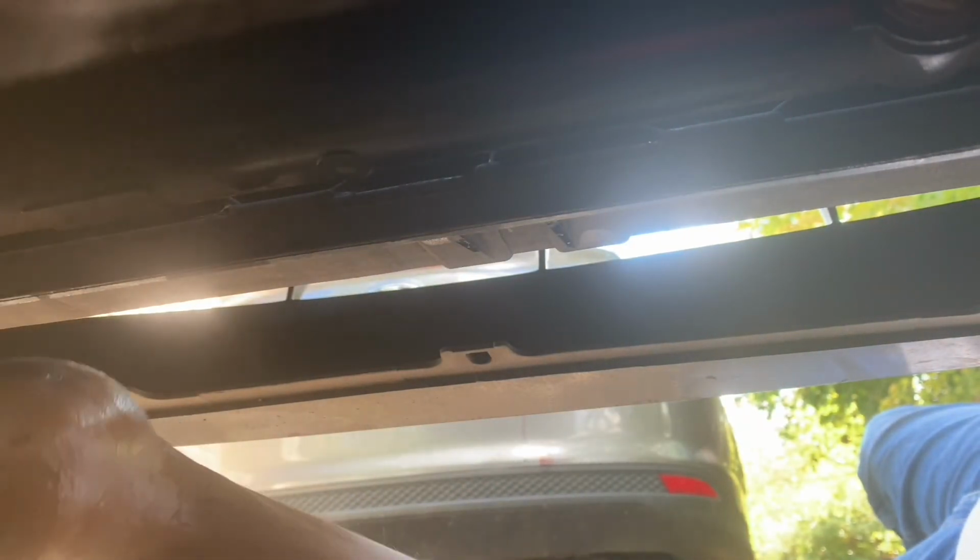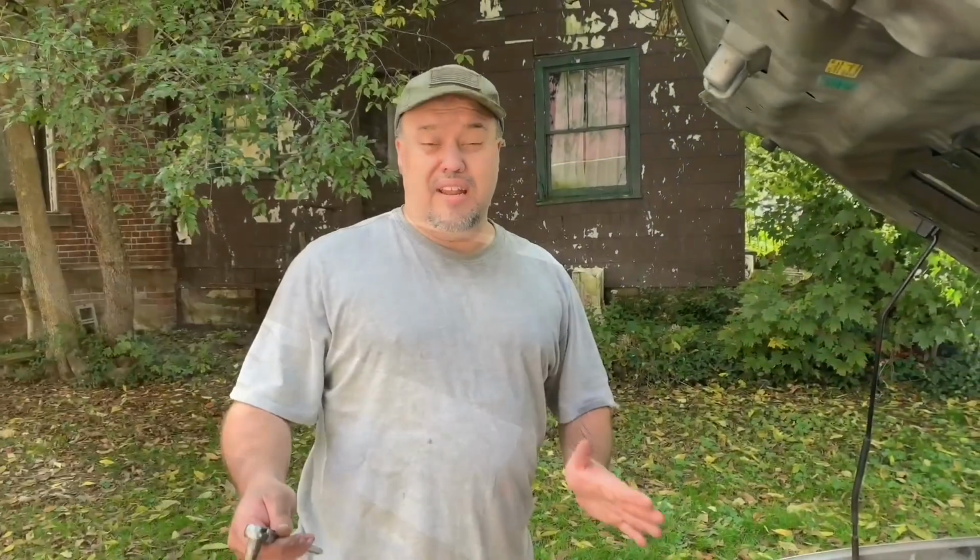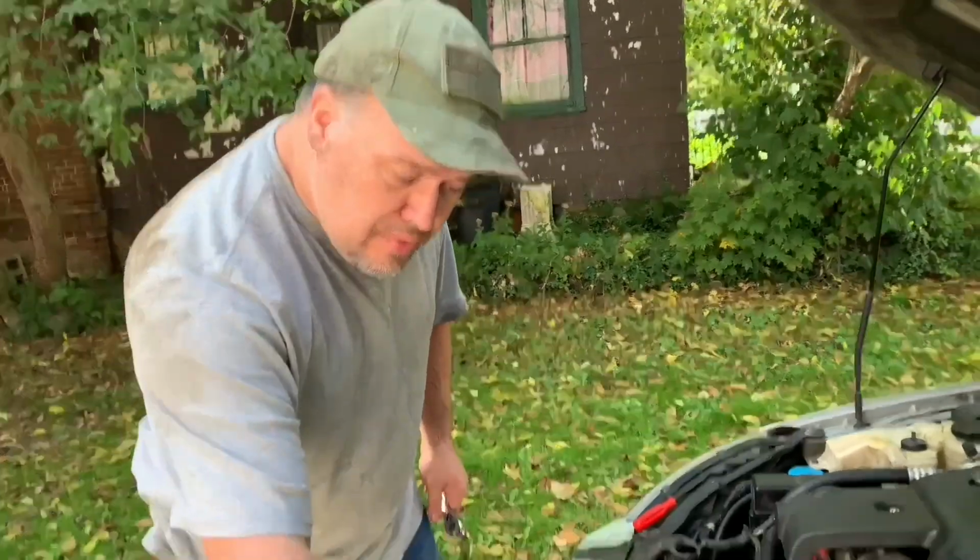Okay, so the first one looked like it went to the radiator, the second one looked like maybe transmission fluid, and this one looks like oil. And you're going to pull it off of the radiator. It's connected by a little plastic tab. Just take it off of there and then put the hose up out of the way. And then if you look now, all three of the hoses are disconnected, as you can see down there too. There were 3 altogether.